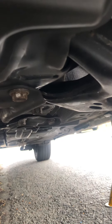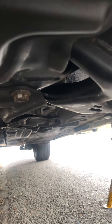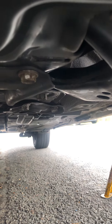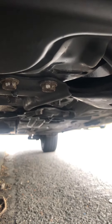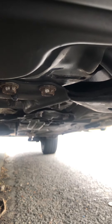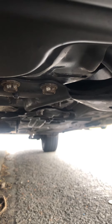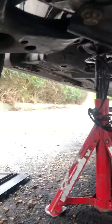After that, you need to check the suspension arms. Even though the rubber might appear to be okay and not damaged, the suspension rubbers have a tendency when they're worn to become too soft, so when you go over a bump they bounce too fast. Of course, also check the shock absorbers and top mounts — they are the last thing you should think about. The top mounts do fail. If you suspect something, go to eBay or call your local shop — if that part is being sold by several people or they have it in stock, that means that part is prone to fail.